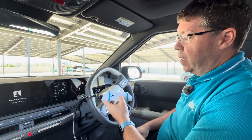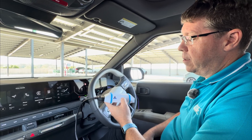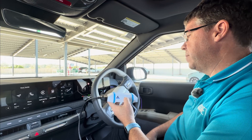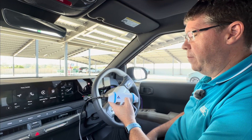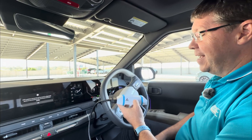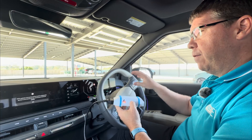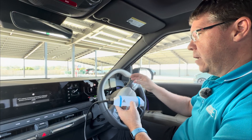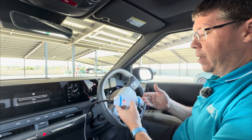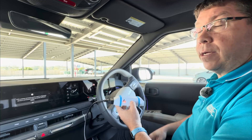This takes about three minutes. This bit will take a couple of seconds — it'll go orange in a second. Does the car know you're doing this? Sort of. Some cars do — Mercedes-Benz and BMWs respond to the connection. Now it's gone orange, and that's it taking the VIN number from the vehicle, understanding what the car is. Once it's got that it goes orange solid, meaning it's now started its three-minute cycle.